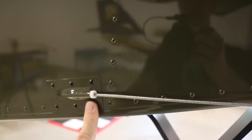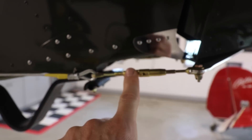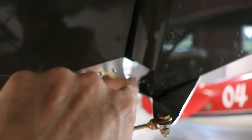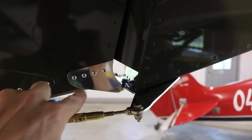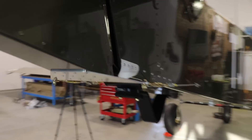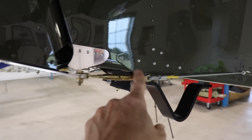I've got my nylon inserts finished up, got the cables run — they're not tensioned yet. I've got these pieces made and you can see I've polished them. I added a nice swoop to it so it wasn't so blocky, and in the front I did the same shape as the leading edge of the horizontal stab just to give it a little flare. I don't have the cotter pin in or the safety wire yet because they're not tensioned yet.